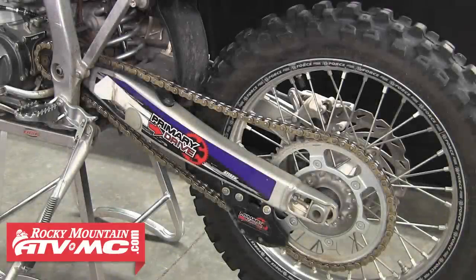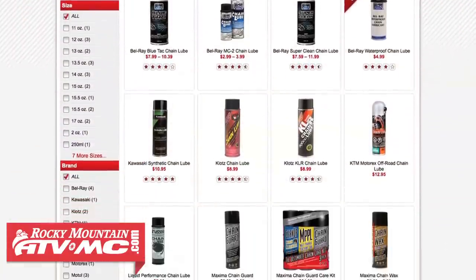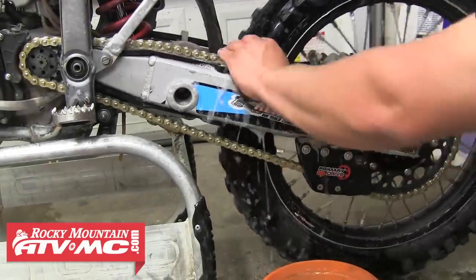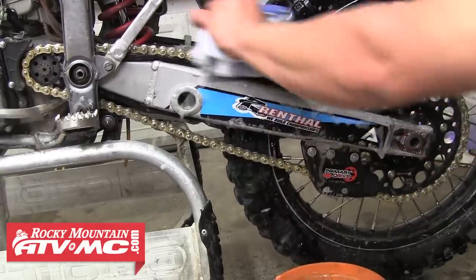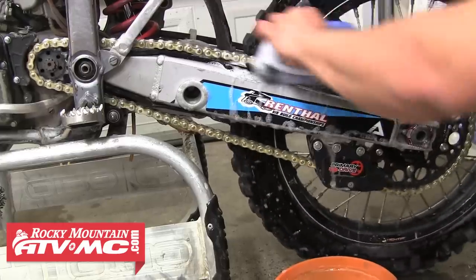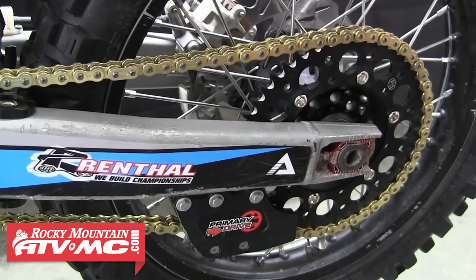The next thing we're going to cover is proper chain care and maintenance. Keeping your chain clean and in proper running order is going to help lengthen the life of those final drive parts. If you have an o-ring type chain you'll want to choose a cleaner that's safe to use with o-rings. Hot water and soap can work to remove a lot of dirt and grime. If you choose to use a degreaser, this will naturally remove any grease on the chain, so use it sparingly and wash it off after cleaning. After that, apply a good chain lube to re-lube the chain for operation.